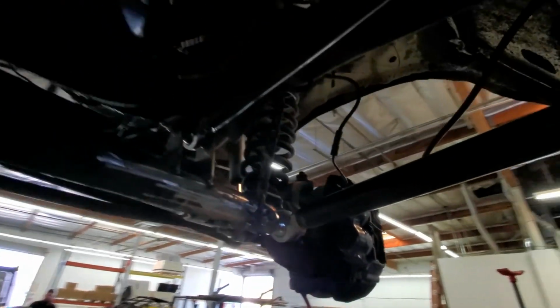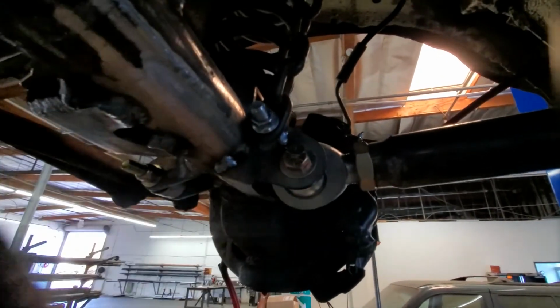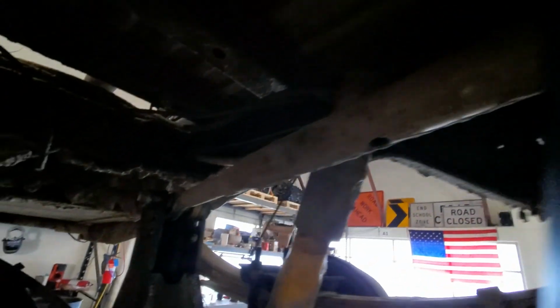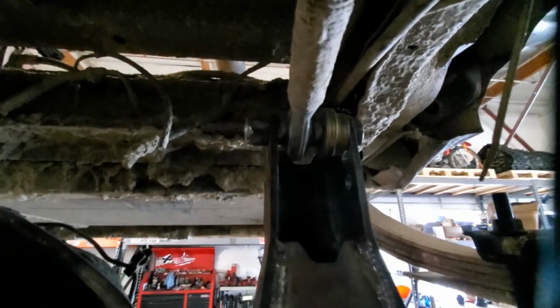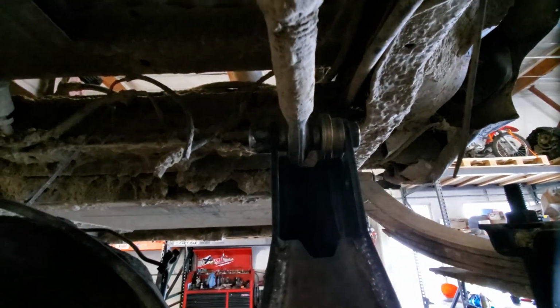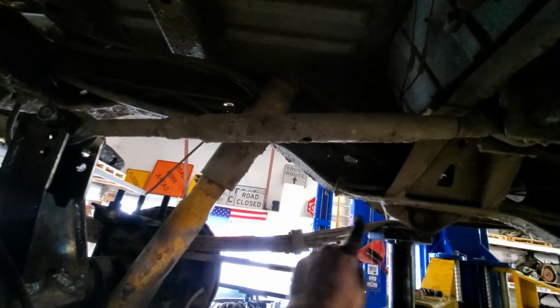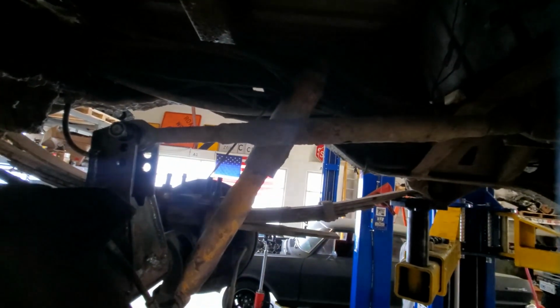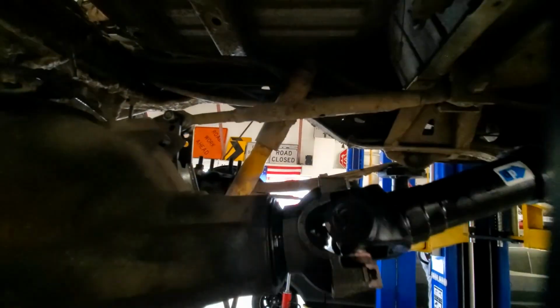Take a look at the suspension. So this is the suspension. There's one of those. In the back is how we did the anti-wrap. It's just welded to the cross member. This is a Harbor Freight tractor top link. And that's some washers and various other stuff. Slid off the axle. The idea here is that this is roughly parallel with the point between that eyelet and the spring where it attaches. Kind of, more or less. Good enough.